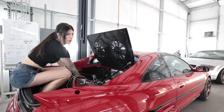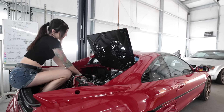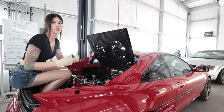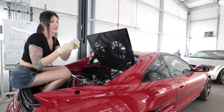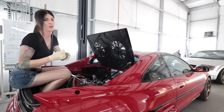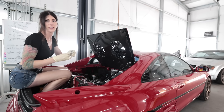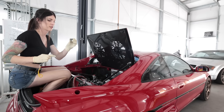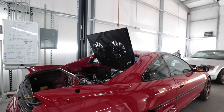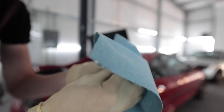End cap is on. Before I stick these injectors in their new home, I want to make sure it's nice and clean down inside there. The new injectors came with these little injector cups — actually I think the fuel rail came with them. It sits further away from the valve cover. Nothing like dropping my injector cup on the dirty floor. This is tricky enough to do on its own, let alone when you can't look down because your nose is just running crazy.